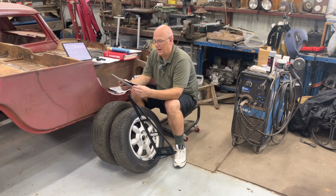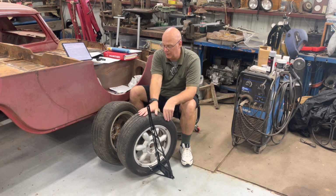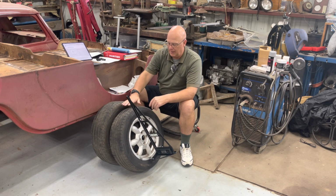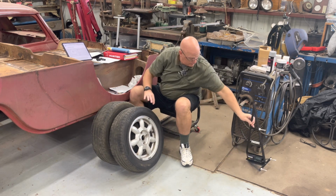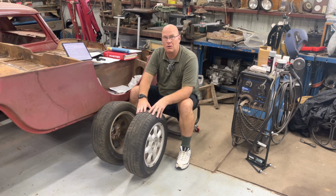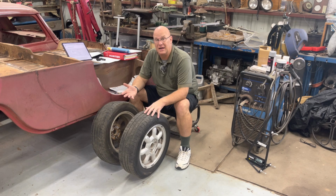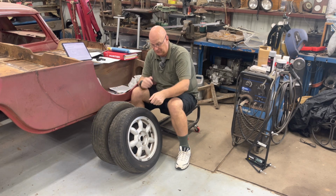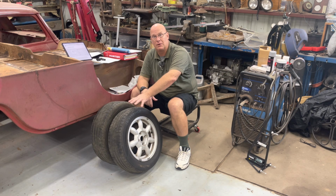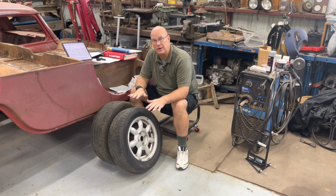That is how you get it using the camber gauge. But you have to know where 20 degrees left and 20 degrees right is. And when you're turning the wheel, you have to be able to turn it with the weight of the vehicle and all the suspension on there. The best way to do that is something called caster plates. Any place that has an alignment machine has these plates that sit on ball bearings and rotate. And for the last 25 years, any alignment lift you buy has rear caster plates too.